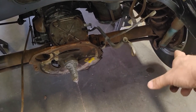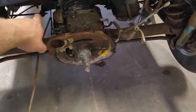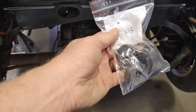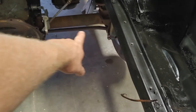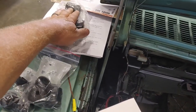What we're after on this particular episode is shock absorbers. You can see the bushings are completely gone down there. So I got those here. Little sway bars clear up front there. All the bushings are shot and cracked. Got two sets of those. Our strut rods going parallel to the drive shafts down there. The bushings in the ends of each are completely shot. So I got a set of those.